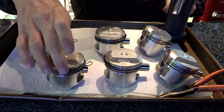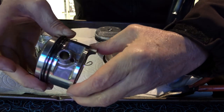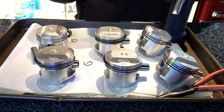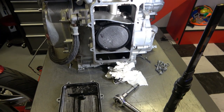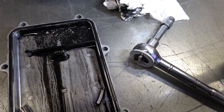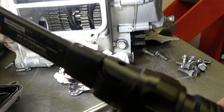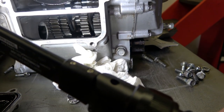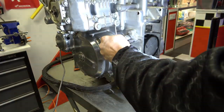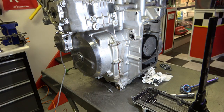Actually at this point, I'm going to put the honing of the cylinders off until the next video. But right now I wanted to show you the new pistons — I've already installed the rings as shown in a previous video. The rest of this video is showing some of the disassembly of the engine for the second CBX. As you can see here, I've removed the oil pan, which has a little bit of sludge at the bottom — pretty much to be expected on an older bike. I'll be covering some of these other items in following videos.